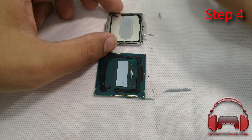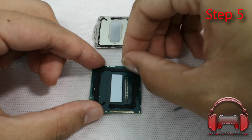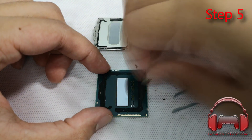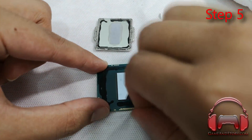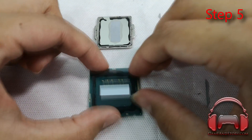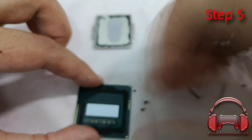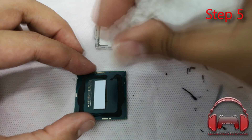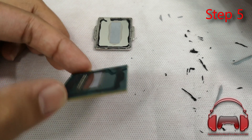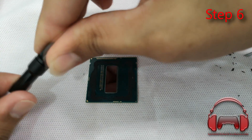Step five: use your fingernails to remove the silicone sealant you'll find around the CPU die. You can use something like a pen knife or cutting knife if you feel adventurous, but I stuck to my fingernails to avoid scratching the PCB. You can use isopropyl alcohol to help clean off any excess thermal paste and the rubber sealant — get it as flat as possible.